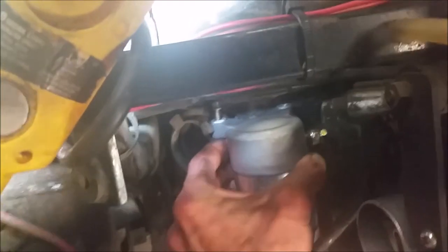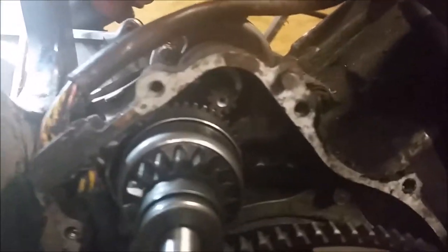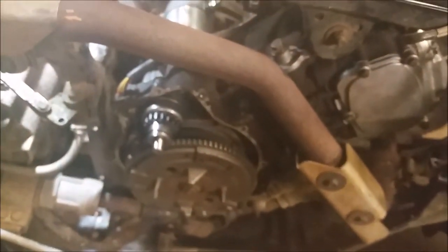You can just push this back in — it'll drop through that hole. I'll be pushing this back in while I'm pushing it down. Got it shoved into place, just going to wiggle that in. Make sure that your gear is lined up with that gear. Then you just do the reverse: tighten this nut up, put your ground wire back on, put that other bolt on right there, hook your power up to your starter, put your cover back on, and you should be good to go.